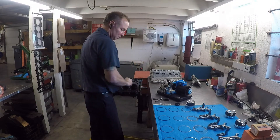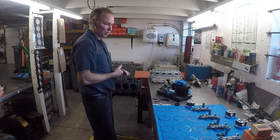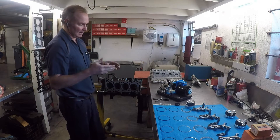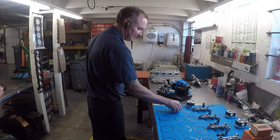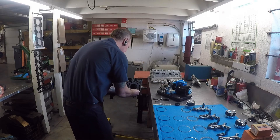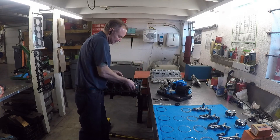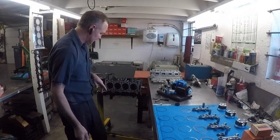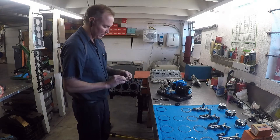Both oil control rings measured at 18 thousandths, which is completely fine — the bigger issue would be if they were too tight. That's confirmed as expected for this F-Production Miata engine with a 40-thousandths overbore. Now on our second ring, we're probably going to be a little under spec. I put it in the bore and I can't even push it all the way in because the two ends have touched — it's way too small.